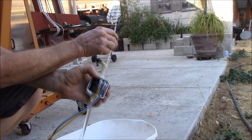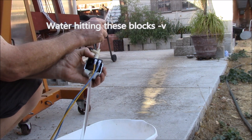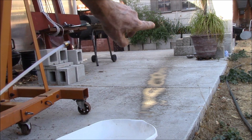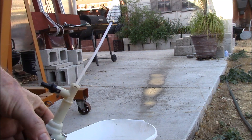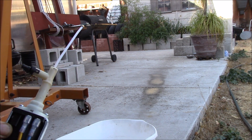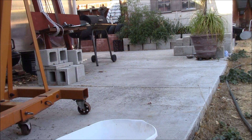There we go — it's sucking up water. Let it build up some pressure. The far bricks under my tomato plants are at 22 feet, and I was just getting to the base of those blocks. That is the flow and pressure out of this new pump. Once I get the old pump out of the machine I'll run this same test and see how far it pumps, because if the old pump has low pressure it won't shoot the water as far — that'll be a reasonable test of pressure.